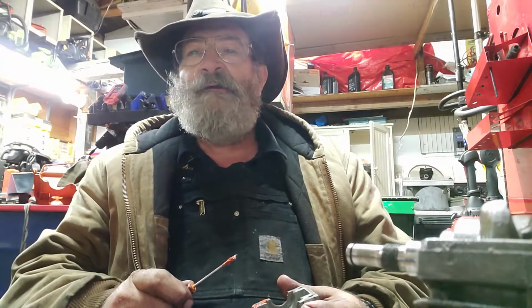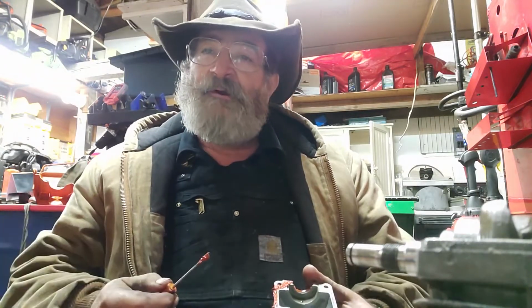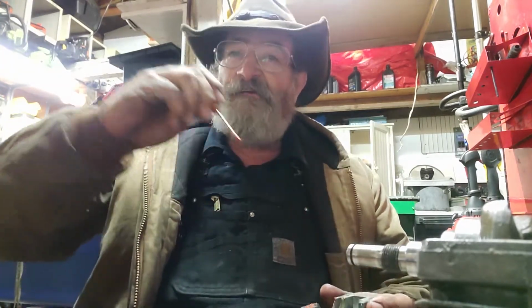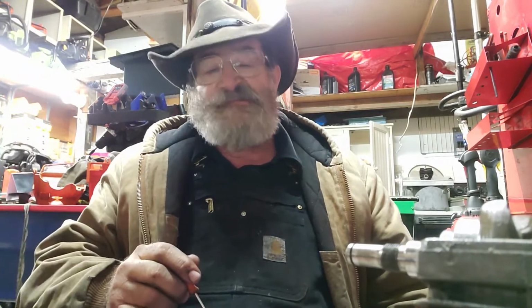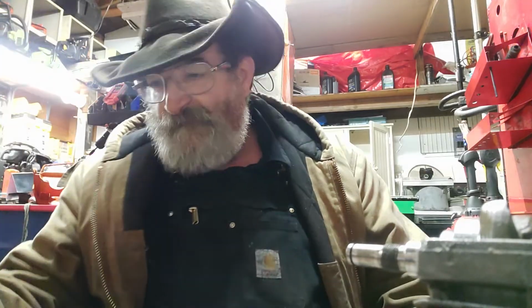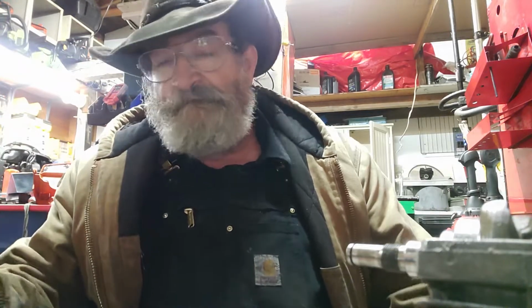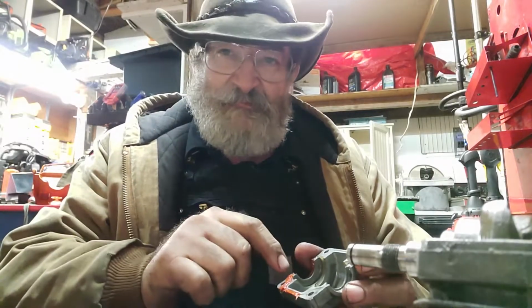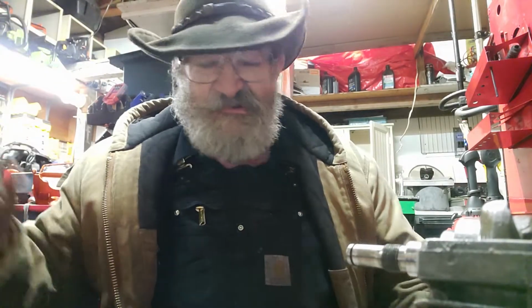What in the heck is going on? Well, I tore it apart. I had a heck of a time getting that doggone piston out of that cylinder, but I got it out of there, and I found a streak of dry red silicone right up the side of the rings. It wasn't dried inside the silicone, but it was just like a big old string. It looks like a big old silicone spaghetti string stuck right in there, just locked it all up. So anyway, I pulled that spaghetti string out of there and cleaned her up a little bit and fired her right back up again. But you want to make sure you stay away from that, because just a little bit, it'll just stretch all the way through there.